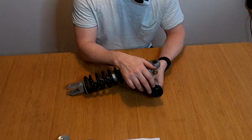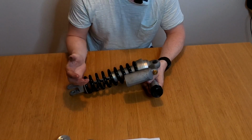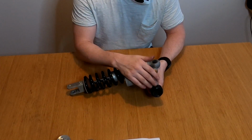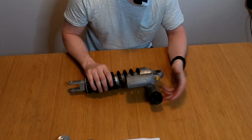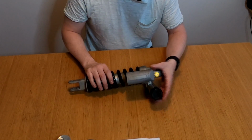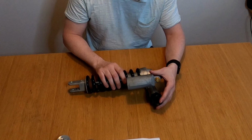And it's good for, if you have a pillion rider, or if you have a lot of bags and stuff when you go out on adventures, then the preload is golden, right? And we're missing preload in the front, and that's one of the drawbacks with the OEM setup, and we will come to that in part 2 as well. So that's pretty much all about the front and rear suspension, the OEM one.